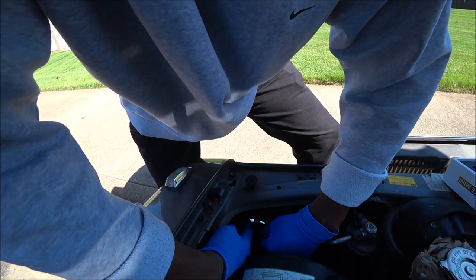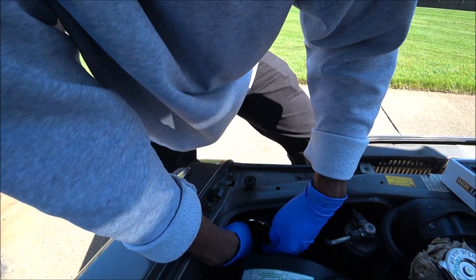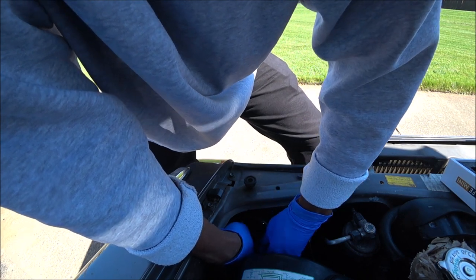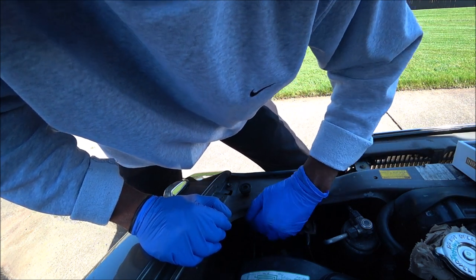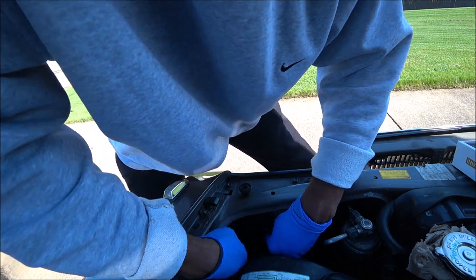So you're just going to push this boot out just a little bit, kind of fold it backwards. Just going to feed this in there to lock it down. And now that the tensioning spring is reinstalled correctly, now you can go ahead and press your boot around the casing of the headlight assembly. Just like that.